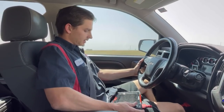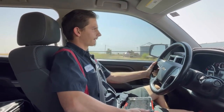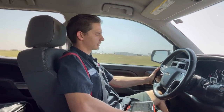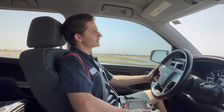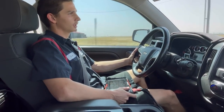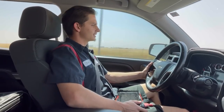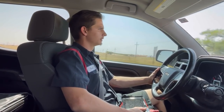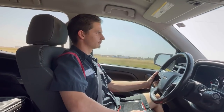Transmission is at 188 degrees. This one has a big cooler on the front. Some vehicles have small ones, some bigger ones, and some just run straight through the radiator with no cooler — definitely not an option I'd pick. This one has a cooler bypass valve, so it has to get up to a certain operating temperature before it starts flowing. Always make sure they're cleaned out and working correctly; if not, replace it and get a new one.